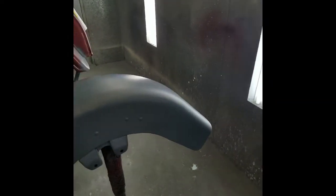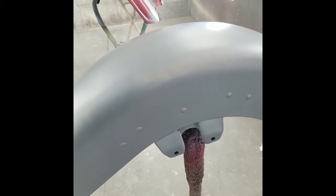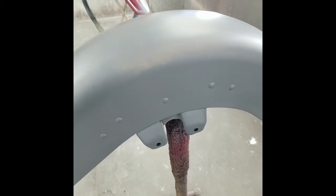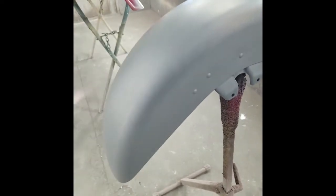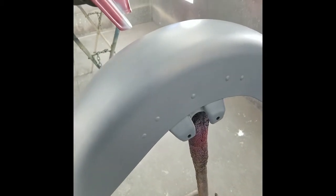I've decided to do the silver stripe first. The reason is: I'll lay the silver stripe, come back and put my 1/16-inch stripe on, then measure an eighth-inch gap in between using my guide. Then I spray the red — the red will cover the silver. If I did the orange stripe first and came back to spray the silver, it's harder covering silver over red than red over silver. You don't want to build up too much edge against the red when you're done, so go with the hardest color first, which is the silver.